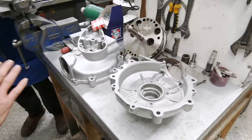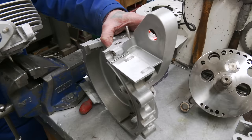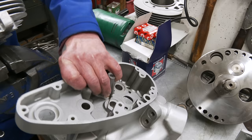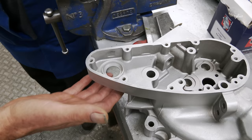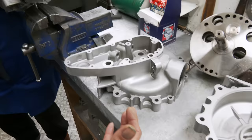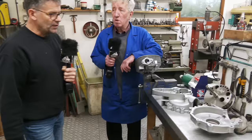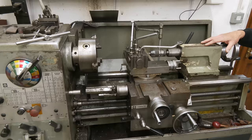Looking at the crankcases - Phil has replicated these too, done everything. The mag platform is a regular thing that comes in needing work. With the mag straps vibrating here, it wears quite badly. Phil has had to build up with weld and re-machine it - full of weld - and you wouldn't know it had been done. The process involves putting it in a de-coking tank, then vapor blasting to get a lovely finish.